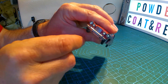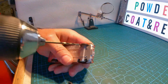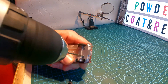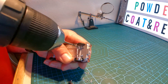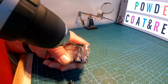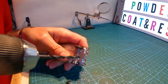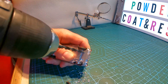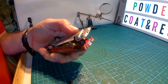It's got the dual headlights. First of all we're going to just drill out the two rivets with a pilot drill, and then just a larger drill to drill out the flanges of the rivets. And using the dentistry tool we can just lift off the base.